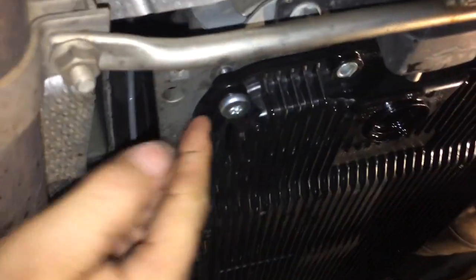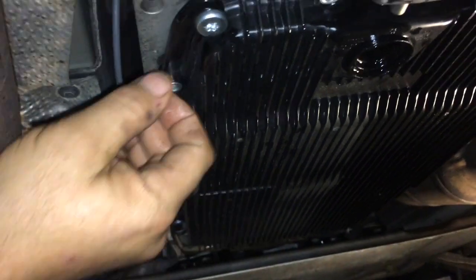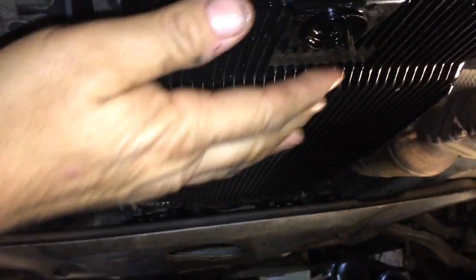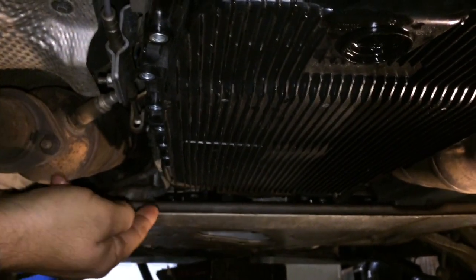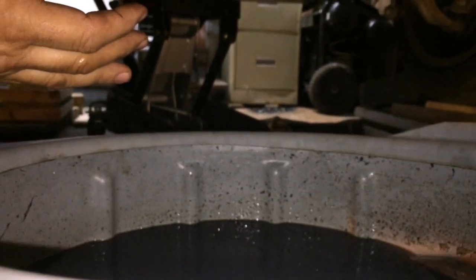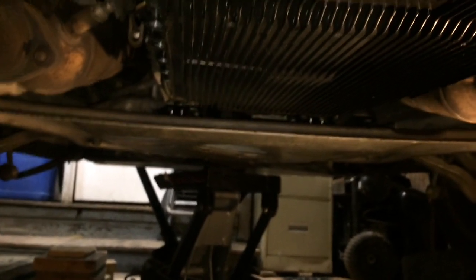There's just a few threads left in there, you see what I mean. Then I loosen the back ones less so that the pan is tilted toward this way. Then it'll just release. What I do is I take both bolts out on this end — when I do that it'll all come spilling over the edge, so you want to make sure you have your pan ready. Once you've done that, go to the other two corners. Take those down, then you'll be able to raise your pan up. Be careful, there's still going to be some fluid in here. Let that drain down into your pan — look how murky that stuff is. You don't want to get it on you.